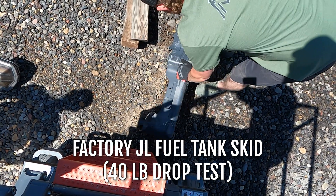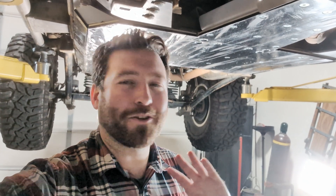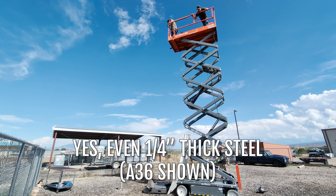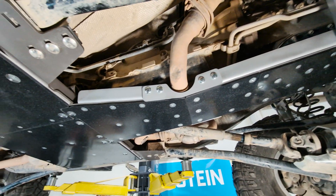The last thing — and this is kind of where it all started — was keeping it lightweight. Do you want to add 150 pounds of steel underneath your vehicle, or pull out all the factory steel parts that are no longer necessary and add something lightweight like aluminum? We're doing the same thing, just with 7075 T6 now. While the previous skid plate system didn't fail me, there was one major gripe: hit them hard enough and they dent. So we designed in enough room that even if they started to bow, bend, or twist, they're not going to be so close to your transmission pan that they wear through and present a leak or failure.